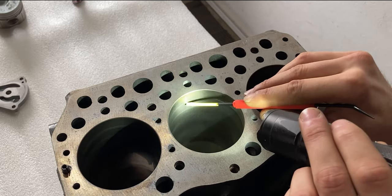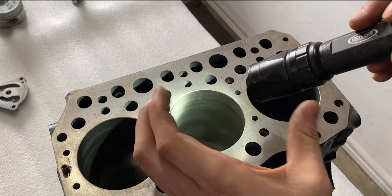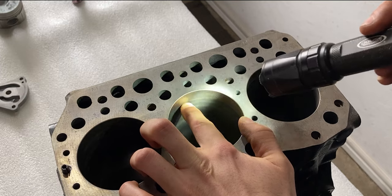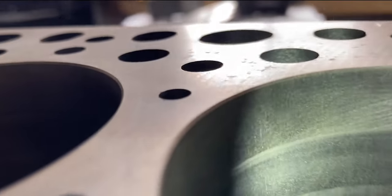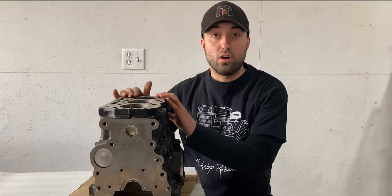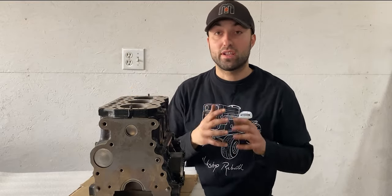That step means the top of the bore is larger than the bottom — there is wear in the top half inch of the bore. From the very top machined surface downward to where no piston ring reaches, the bore is smaller again. A close-up view still shows the crosshatch along the cylinder wall. I reviewed all three bores and found wear towards the top — the bore is likely out of spec and needs to be rebuilt. I do not believe it was 'dusted' because there are no score marks going up or down, and the pistons have no scoring either.